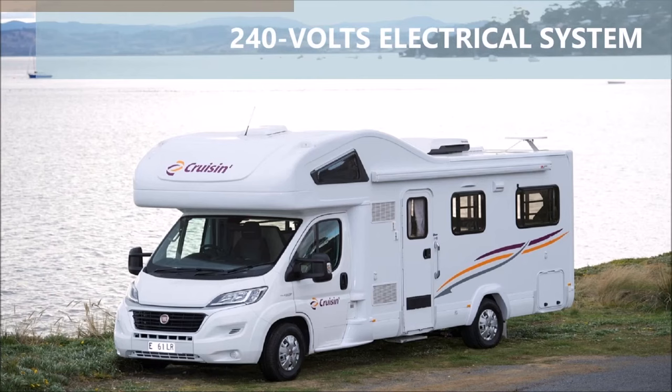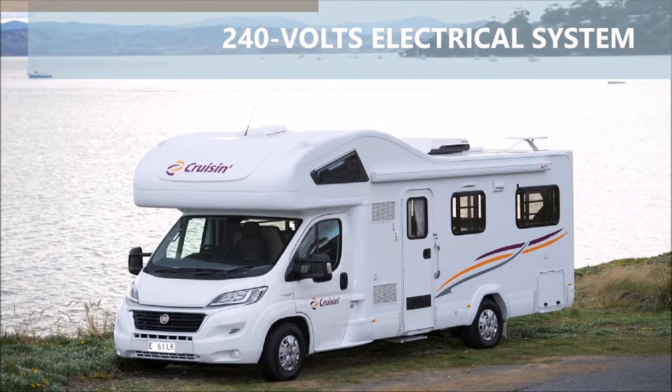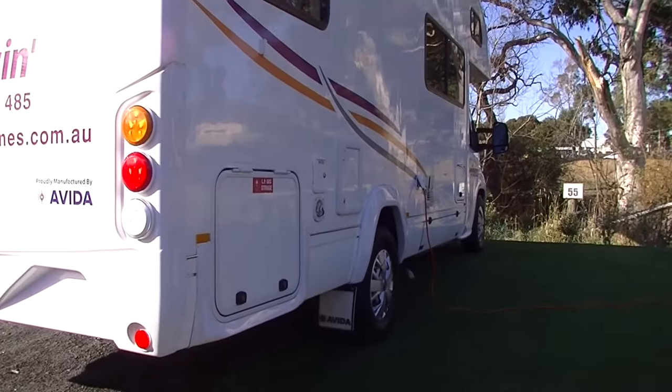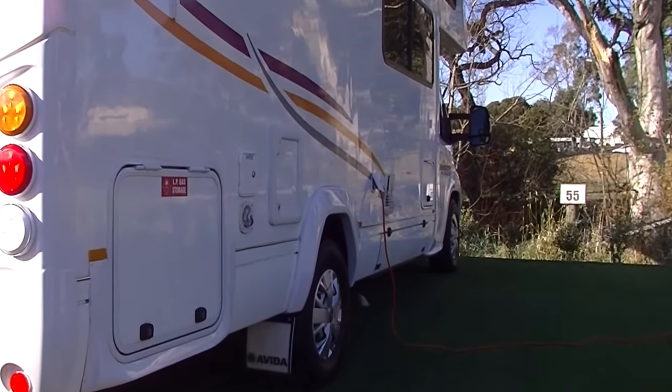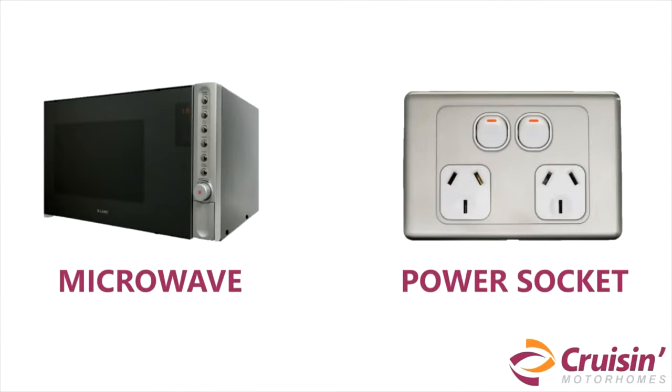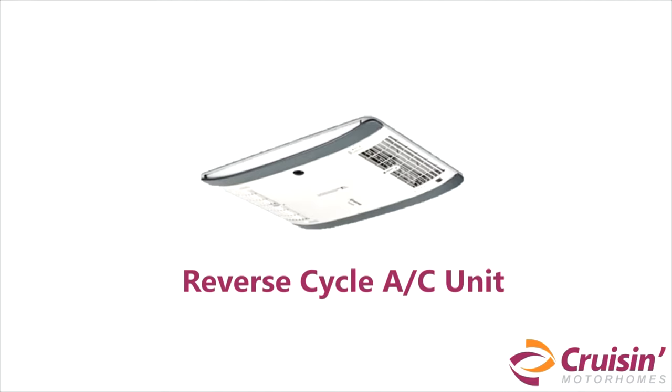The vehicle needs to be plugged into a 240-volt mains power source at least every second night to charge and maintain the 12-volt house battery. The following appliances only work when you are plugged into 240 volts main power, including microwave, power socket, battery charger, and reverse cycle air conditioning unit in the vehicle.